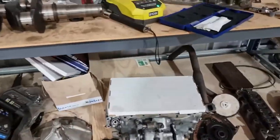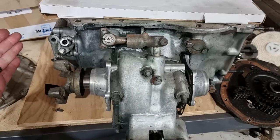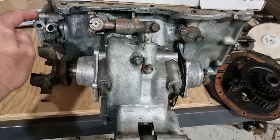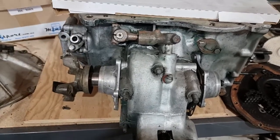I'm going to jack the side of the car up, get the wheel off, and get the suspension apart, attending to the speedo cable and the bearing — taking the front apart gives me options because you've got to do it anyway to get to the speedo. The speedo drive is on the passenger side, same side as the problematic bearing, so I've got to get in via the wheel well to unscrew the speedo from there.